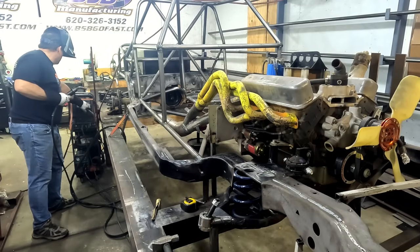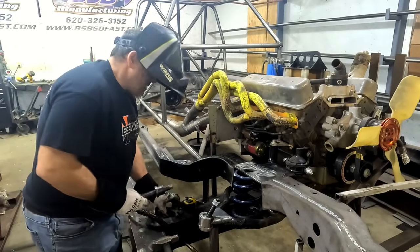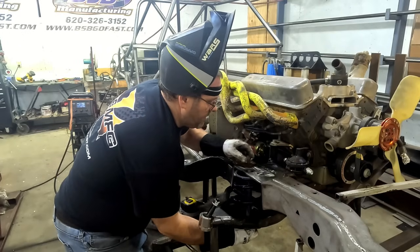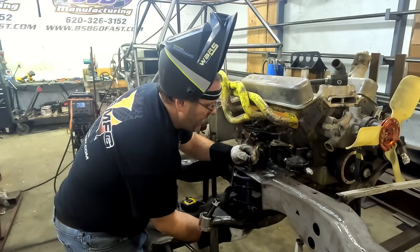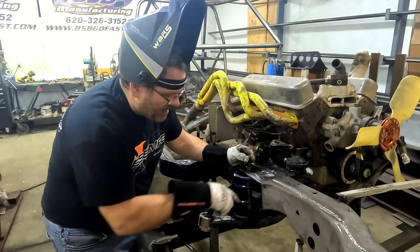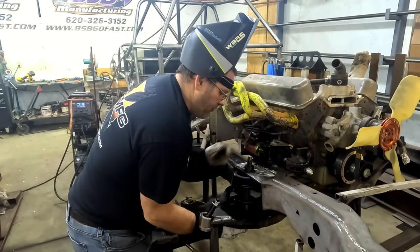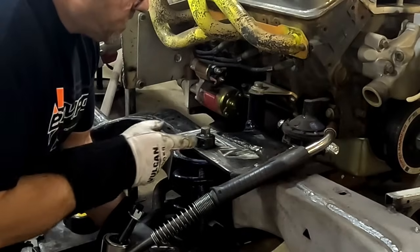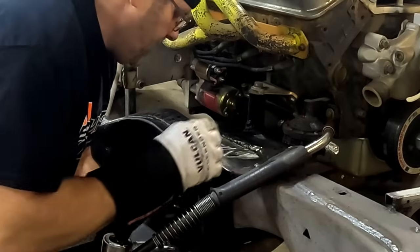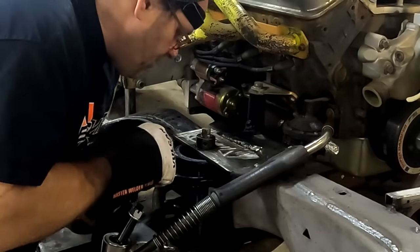Getting the numbers back where they need to be. Now here's what we're doing: we're sliding this jack nut up through here. If I was to mount this flat to this plate, the jack nut is over in the corner of this spring — and that is not where we want it. So I'm going to get right up underneath here and turn the grease fitting where I can get to it. I'm putting the bolt right in the middle of the pocket — optimal location.